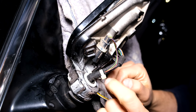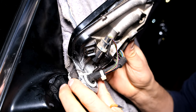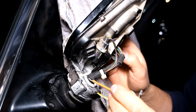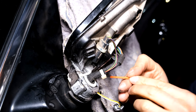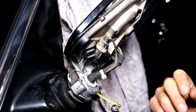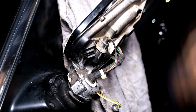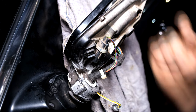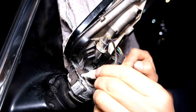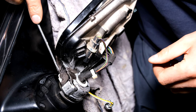I'm just going to put some putty over here so that the glue does not run over here. Now this plastic bushing actually moves, so all I need to make sure is that the superglue does not get between the plastic and the shaft. If it touches the plastic it's fine, but if it goes between the plastic and the shaft then it's going to be a problem. Putting this putty — press stick, whatever you want to call it — here, and now I can put some superglue. Now just remove the putty and put a little bit more superglue here. This is dry over here so I can just remove this putty.